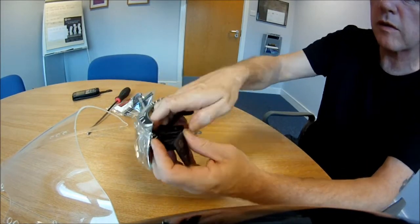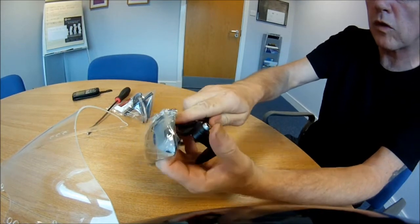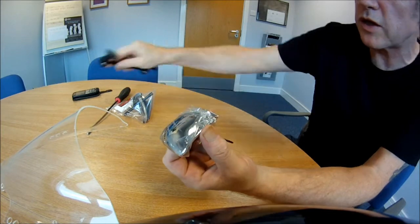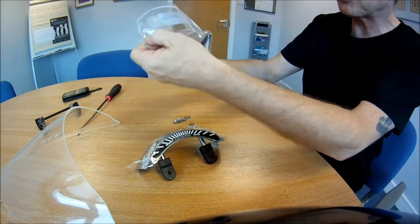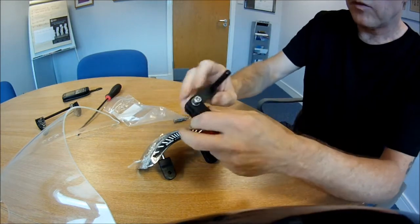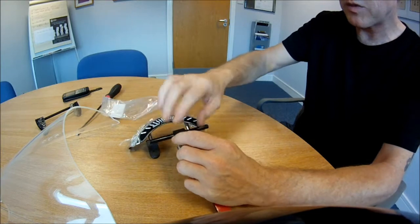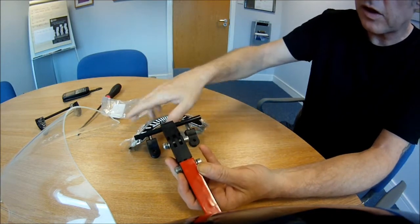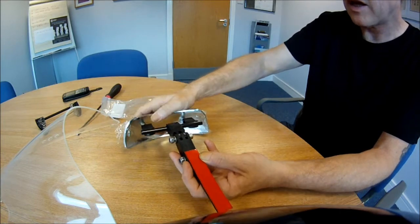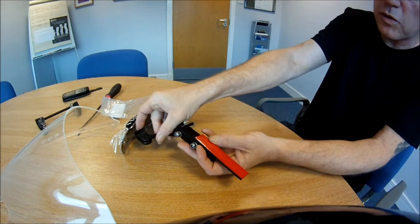So we'll do that. Let's quickly remove that. Holding onto the RiderScan, you don't want it to go skating across the floor. And then of course you open your sports mount. Now you want to put this tie bar into place, but turn it this way so the adhesive is facing the top of the RiderScan, and all you do is simply slide this in, rather like you took the other one out.